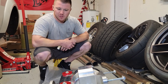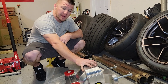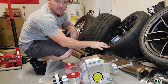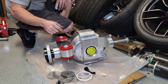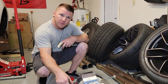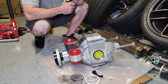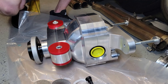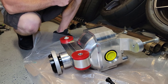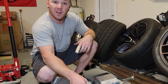I haven't really discussed what we're gonna do as far as the diff. We are doing the billet from AJ Burbs. This piece is about $47 and change — call it $48. I did decide to do the billet diff lockout, but on the front bushings for the diff I decided to go with what AJ sends with the diff itself. I'm not sure of the brand, but they're like a polyurethane — very similar texture to the Super Pro. Very, very hard plastic.